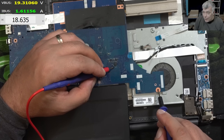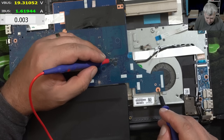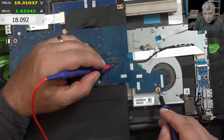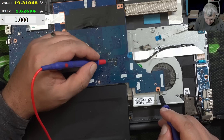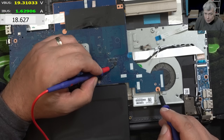Do you think my cable from the power supply is poor? I'm losing nearly one volt on the cable. 18.6V — okay, we took the motherboard out for nothing! I really thought it was a secret but it's no secret — my power supply cable is bad.